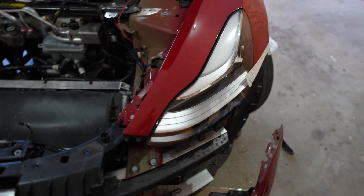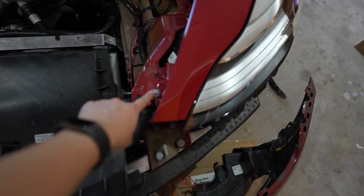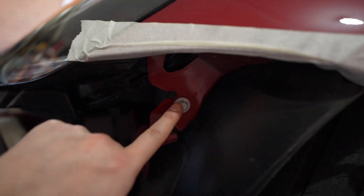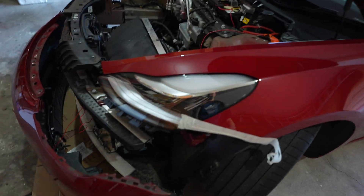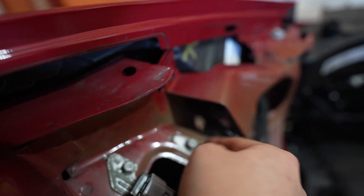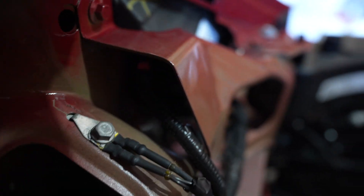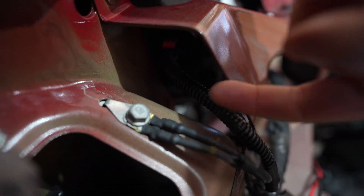We should be able to free the headlight now. The headlight has two bolts that hold it down. The service manual says there are three, but my car only has two — there's one bolt here and one bolt there. According to the manual there could be a third bolt, but my headlight doesn't have it and the new ones don't either, so maybe it's a legacy thing. Before we remove the bolts though, there's a power cable we have to remove. It's a bit hard to get to — there's a red tab on the connector that we need to pull out first, which will free the rest of the connector.